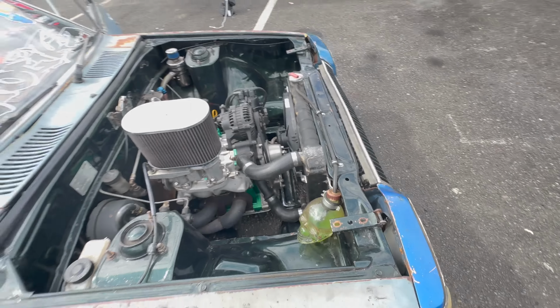It's those rotors, man. Yeah, I would agree. Before, the last block was FC, the heaviest and the lowest compression of the rotors from that 90s era upwards. And these are probably some of the lightest and higher compression rotors that you could use. And the FD plates allow a bigger port than the earlier motor.